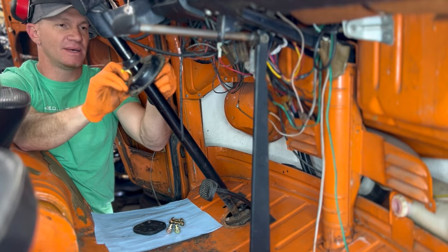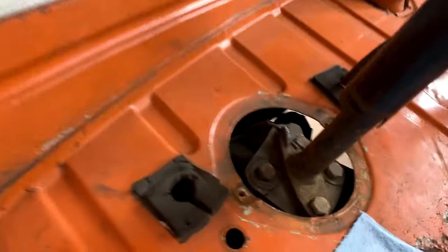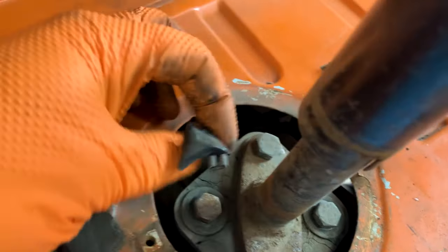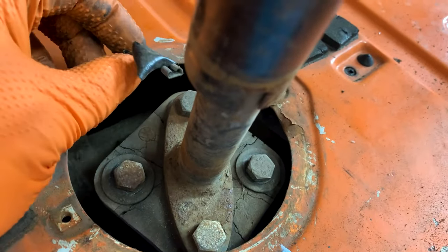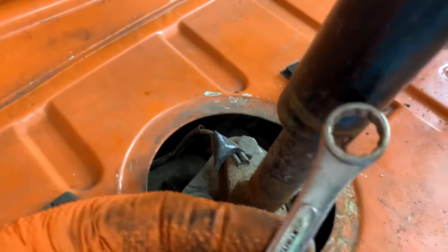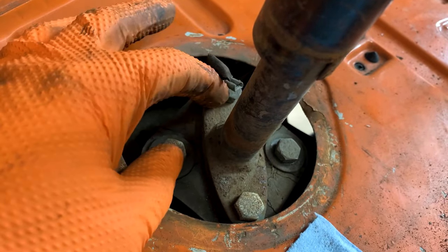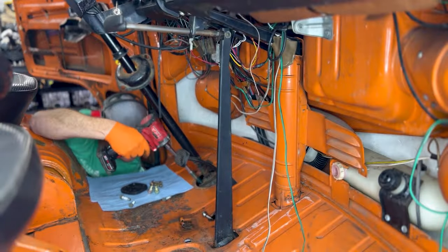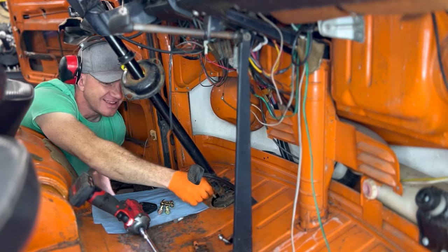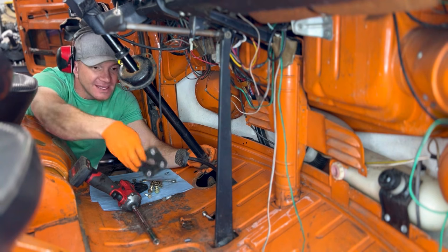Just to make my life a little easier, grab a piece of tape and tape it up. The base of the column's taped up. The steering wheel is off. Then if we come down here, we've got four bolts. I forgot to mention — this wire on the earlier buses connects right there, so you've got to disconnect that and snake it out. Once we have our four bolts, it's just a simple matter of getting a 13mm wrench on the underside and holding it with the box end, then getting your impact or ratchet on the top side. And there we have our old coupler.